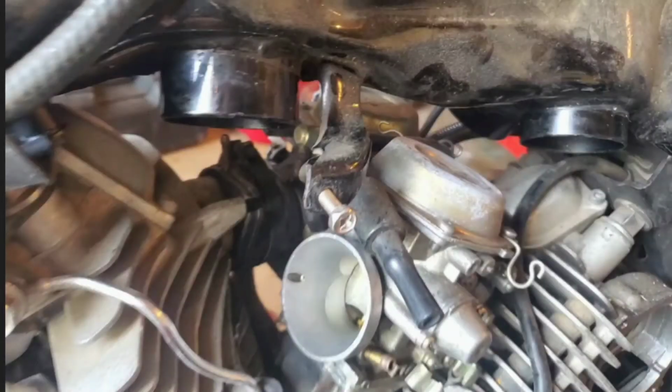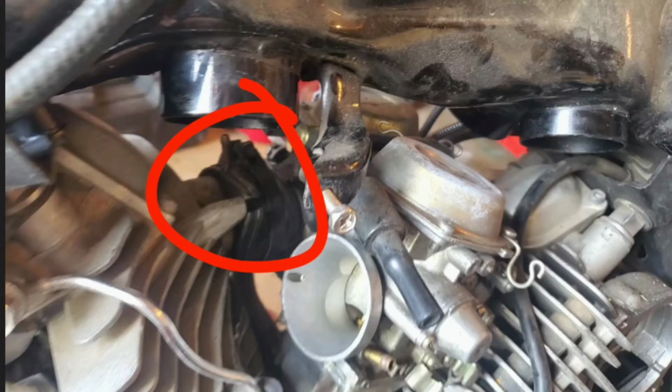So I just realized in assessing all the damage and everything, I totally forgot to show you guys how to slide the carbs out. But basically, once you remove this boot right here, you can slide it out either way. It just comes out through the side. But that's all there really is to it. Man, did you guys see them flakes, though? Those are massive. Yeah, that's going to have to do it for today, because that was over the top.